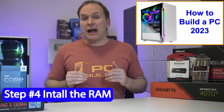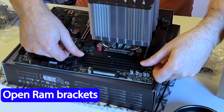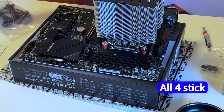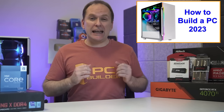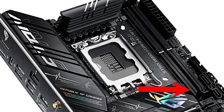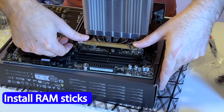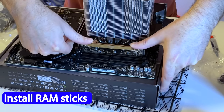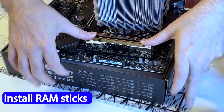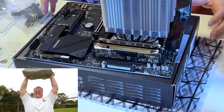Step four: installing the RAM. This is the same whether using DDR4 or DDR5. Open the RAM brackets — almost always slots two and four for a two-stick kit, and all slots for a four-stick kit. Always double check your motherboard manual. Some RAM brackets have two clips while others, like most ASUS boards, have just one. Line up the slot in the RAM stick with the socket and push down firmly with medium pressure until you hear a click. Apply force in a steady motion, not a sudden movement, or you can damage the motherboard. Generally, if you feel like you have to force something, there's another issue that needs to be solved.